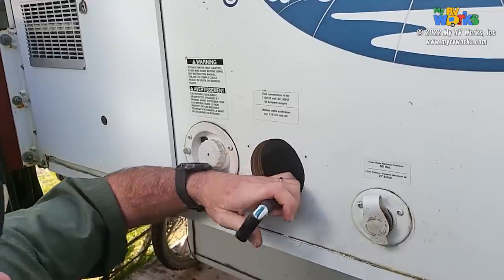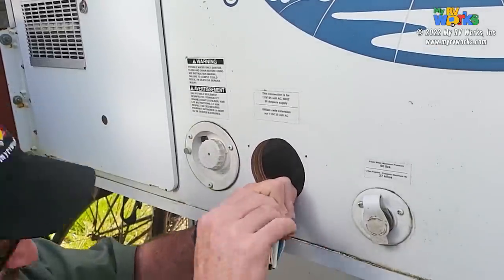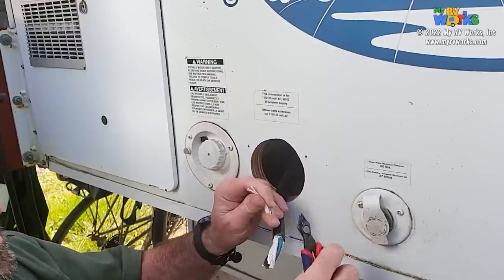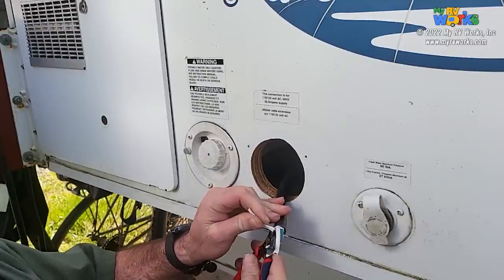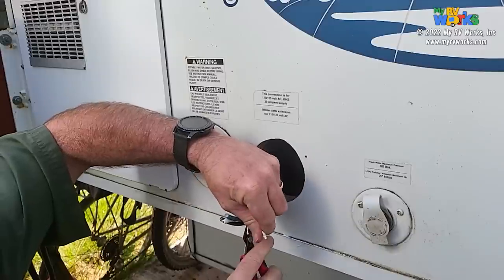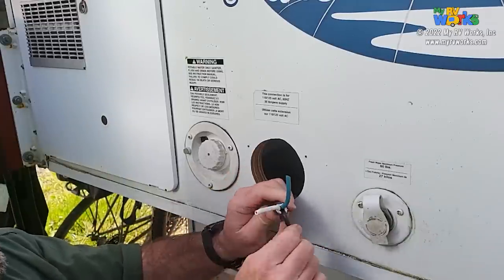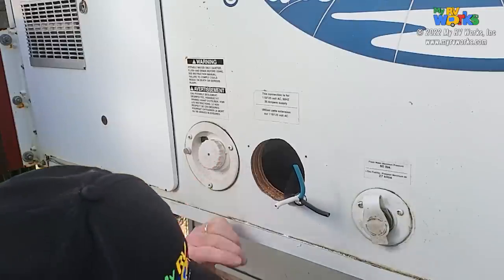So there we go. Okay, so it just snapped. Never once did my knife cut the conductor or even the jacket of the conductor. So then the next thing I'm going to do is I've got these little zero clearance cutters, and I'm just going to cut off all these paper pieces that help it bend and flex without rubbing against itself. Okay, so there we go. Now we've got the business end of the cable here, and we're going to connect it to our donut.